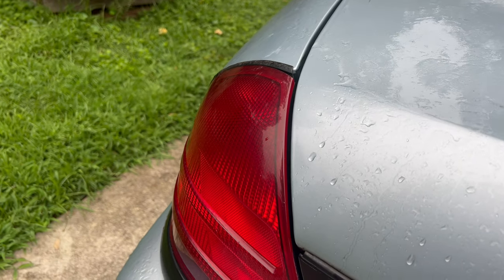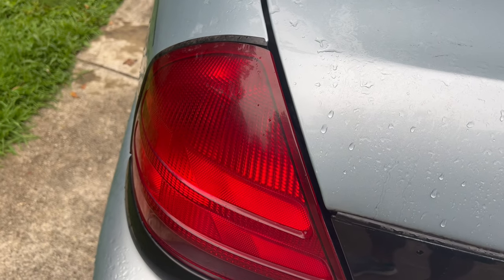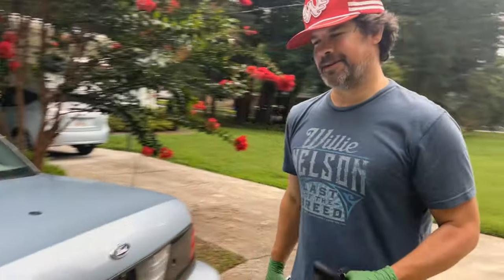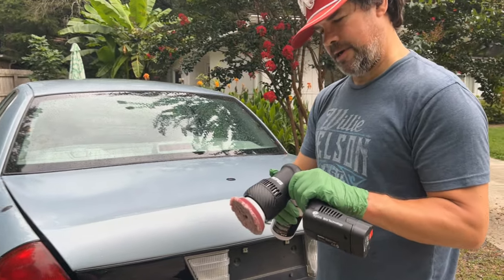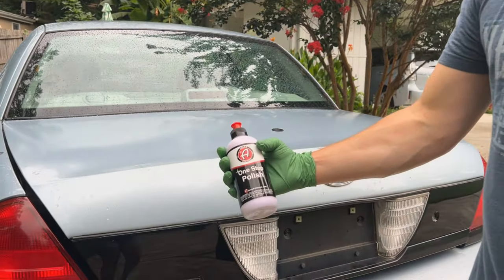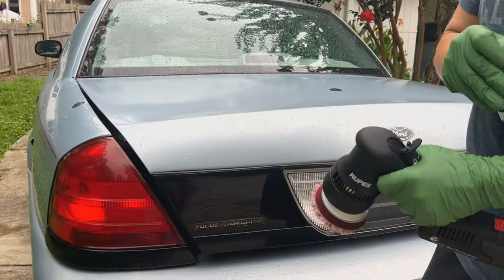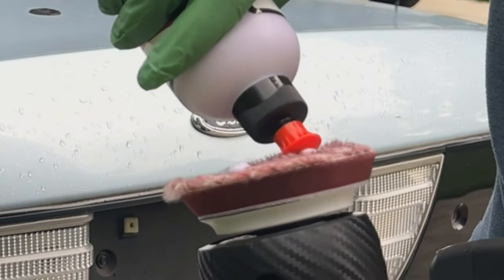There's just not as much reflection off of this. Anyway, I'm gonna clean and clay it and then skip to the polishing step. I've already prepped this surface, cleaned it and clayed it, and now I'm gonna use this Rupes HLR 75 mini — it's a three-inch cordless, so you can go just about anywhere with it. I'm using Adam's One Step Polish. I've already shaken up the polish and got the surface ready, so you just apply some dabs to your pad — this is a one-step microfiber pad.